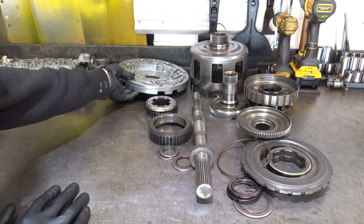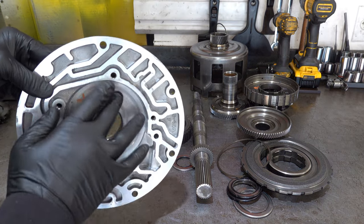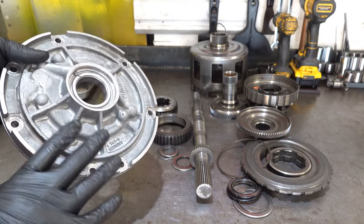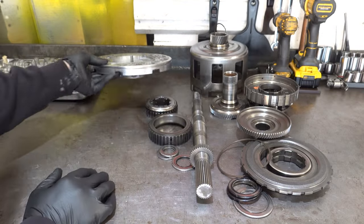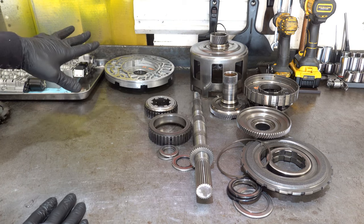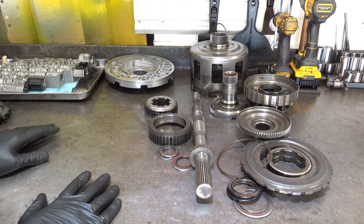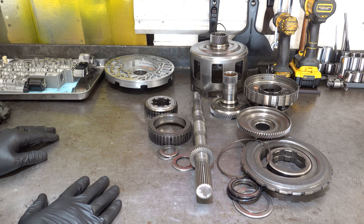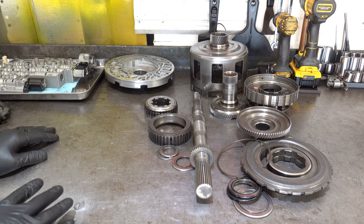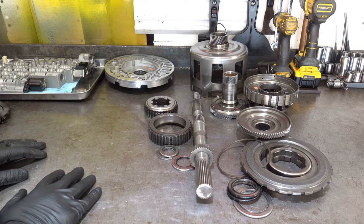The pump, I just have it here on the bench because we're swapping in another machined pump body. This pump body needs to be milled out 10 thou, but the pump did not play any role in causing this failure, at least I don't believe it did. I measured the clearance of the rotor and the slide that came out of there, and although they're a little on the looser side, I want to say it was 2.5 thou for the slide and the rotor. That by itself is not going to cause what you see here.